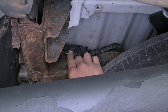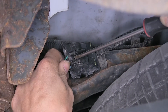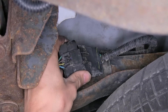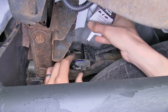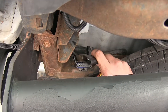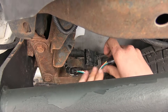There's a black tab on it right here. We press down on this tab and pull to separate. Sometimes it's easier to use a screwdriver to help press down as you pull back. With our connector separated, it's a good idea to take some dielectric grease and place it on both ends. We can then take our new harness, match up the ends accordingly, and place it in line between the factory harness.